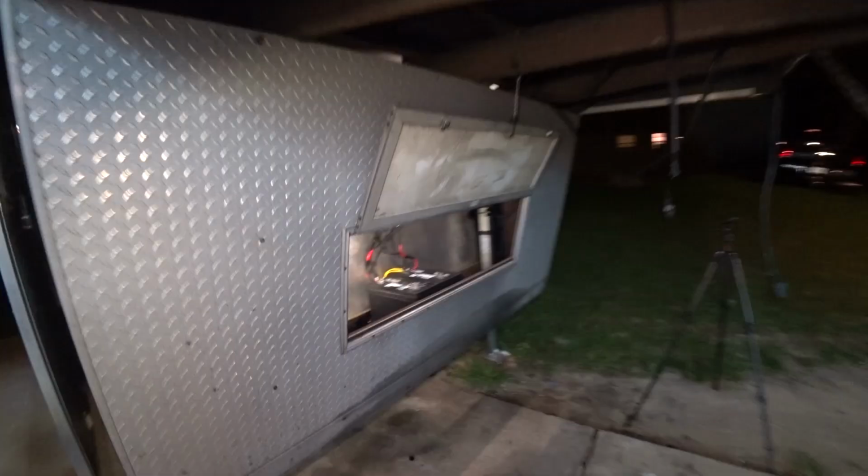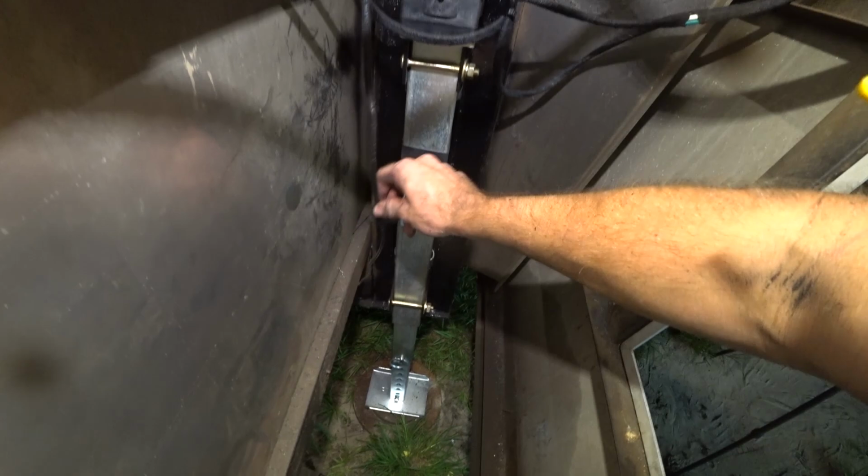All right, so I figured it out. When I was looking at wiring this, I was like, oh yeah, this goes into the inside and is our auxiliary power. I just assumed that because the rest of the wiring goes out in a loom together, which you would presume runs back to the rest of the trailer because it has to go back to the lights. So I assumed the brake wiring is in that. I was wrong. This is the trailer brake wiring. The black wire in this loom is our 12 volt auxiliary wire. So fix that, problem solved.